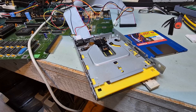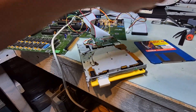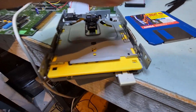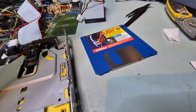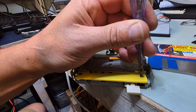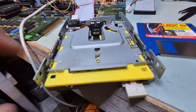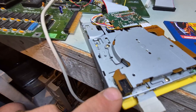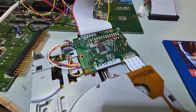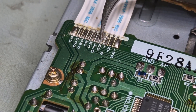I have these floppies here with my Amiga Test Kit and this one has the notch cut out. If I put that in and power the Amiga, nothing happens - until I push this switch here. So flipping it back: this is what defines an HD floppy from a standard Amiga 720K floppy. We need to bypass this switch by bridging, and I believe there's a PCB trace right here - we need to find where the HD pin is and switch that to ground.